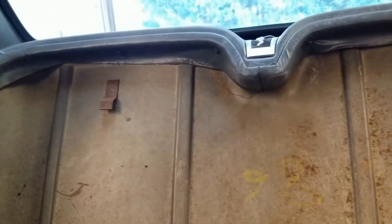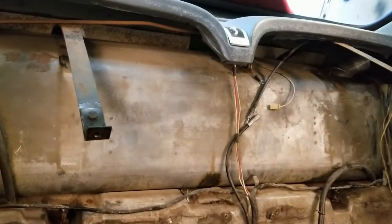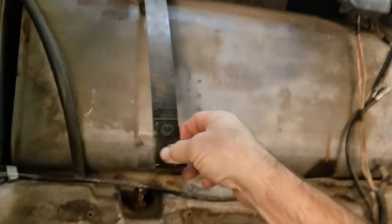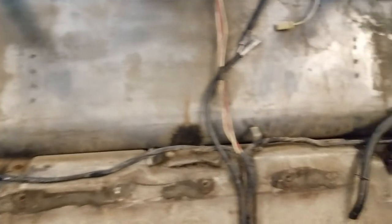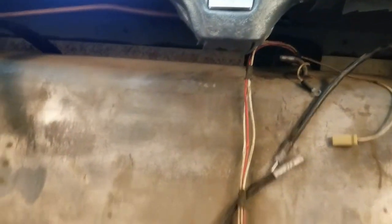Got the seat back out and it looks like it just has some Phillips screws holding it in. That somehow also has the vinyl, so I'll have to reattach that vinyl or leather once I get this done. Making progress — got the straps loose, the feed line and vent tube loose, and the filler grommet out. The tank is officially loose; I still have a few wires for the sending unit to get off.